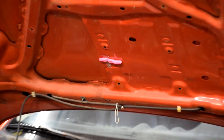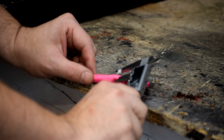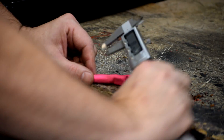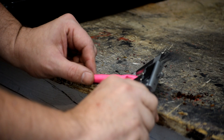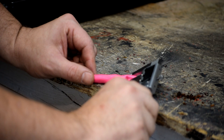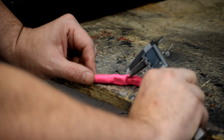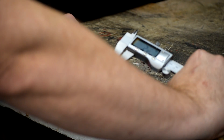There's our plasticine. We can see it made an impression there, and now we'll just take it off and measure it and see how bad it really is. So we'll take our handy dandy caliper. That's about eight millimeters. That section there is about ten, and that section there is about three.